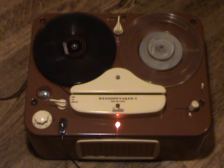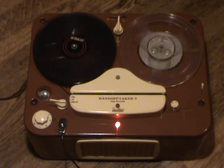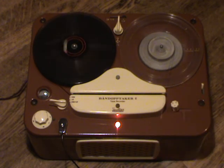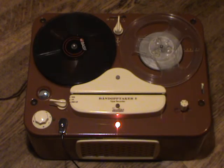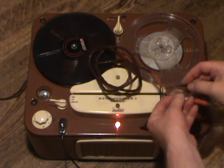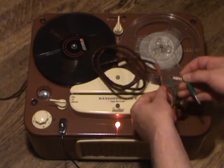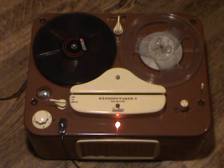Now a quick demonstration of fast wind. It's not incredibly fast on this machine, but with a full reel of tape on the left it does get up to a fairly good speed, indicating that the clutches underneath the reel holders are in good condition. There's no automatic stop — the tape keeps winding at full speed once it runs off the reel until you put the speed selector in the stop position to cut off the motor. This particular machine comes with the original cable for connecting the loudspeaker output to the gramophone input of a radio. Sadly it's missing one banana plug, but it's the original brown cable with colored banana plugs.